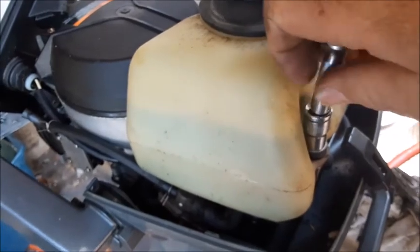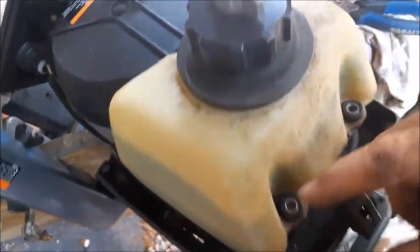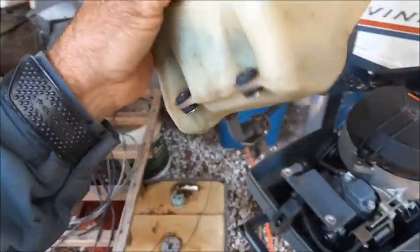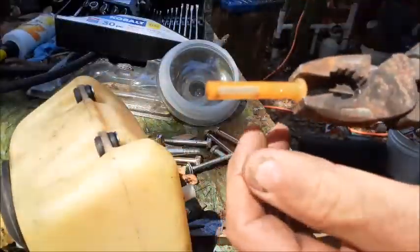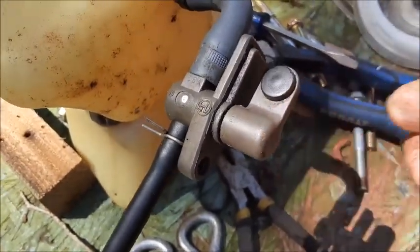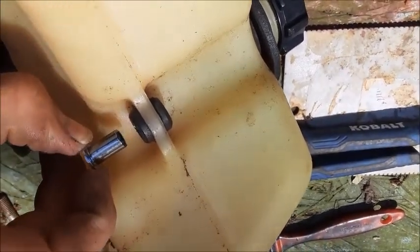Next we'll take out these two bolts that hold on the back side of the gas tank, and there's one more bolt here in the front that holds the front of the gas tank. With these three bolts out, the gas tank is free to lift up out of here — make sure you're not catching down here on the gas valve. Now the whole thing will pull out so you can clean the tank and clean this valve out. There's actually a filter built into the bottom of the tank — you can take a pair of pliers and pull it out of the tank to inspect it. You can see how this valve is all one piece where it just pulls up through the cowling. When you pull the tank out, make note that there's a metal spacer — so this could fall out.